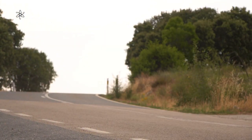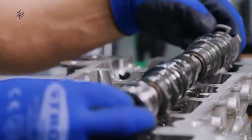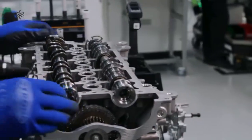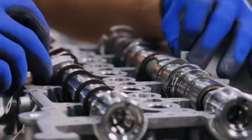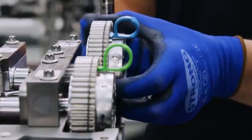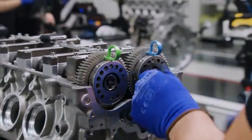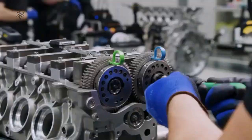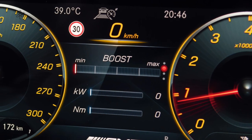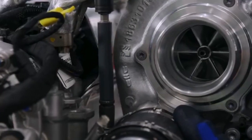Of course, a typical modern economical petrol engine does not make 210hp per litre or 420hp for 2 litres. Even the most powerful turbocharged supercars or hypercars do not achieve this, apart from a few specialist manufacturers. So where does all this power come from on a rather efficient engine? The explanation is a bit of a cliché, but the method makes the difference: they simply rely heavily on turbo boost — 29 pounds per square inch, or 2 bars of boost, on the A45S sport variant.